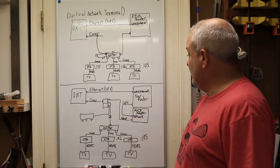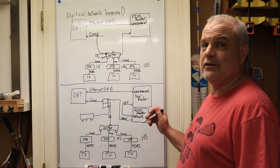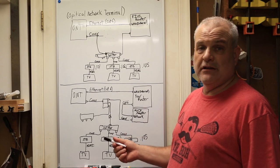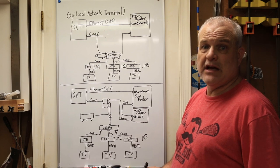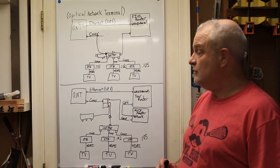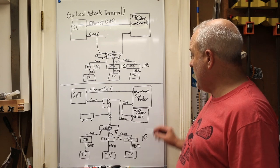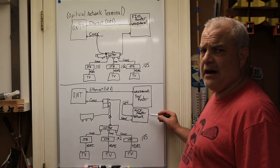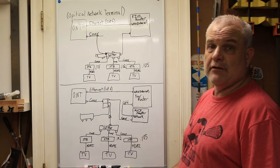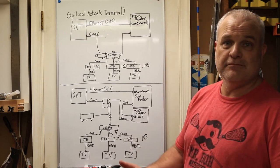I hope this helps. There are a lot of advantages to running your own router — better Wi-Fi speed, range, ability to serve multiple devices, and advanced features like custom settings for an IP phone that the Fios router doesn't always support — plus you save the $15 a month rental fee. The Motorola MoCA adapter costs around $60–$70, and ActionTec sells one for around $20 that I hear also works. I'm not a professional YouTuber, so I don't need anybody to subscribe or like — and if you don't like it, you got what you paid for. Thanks.